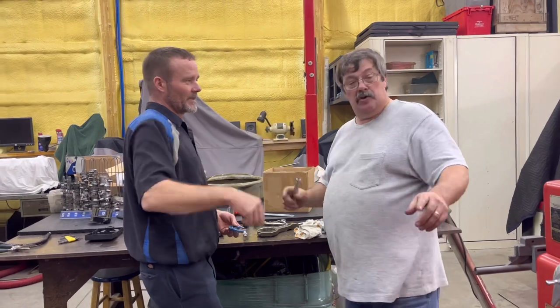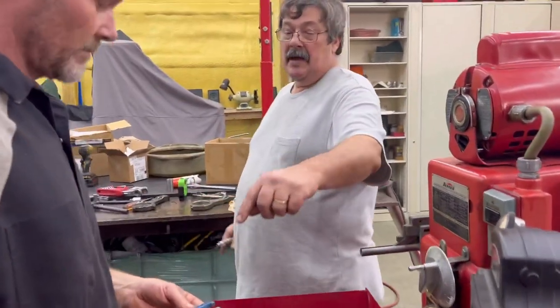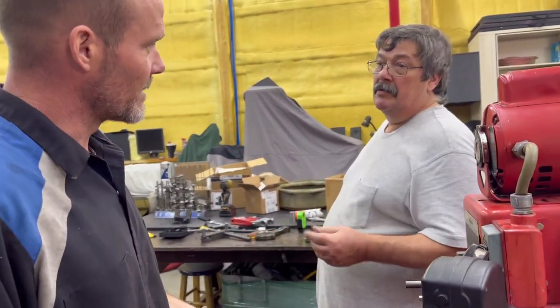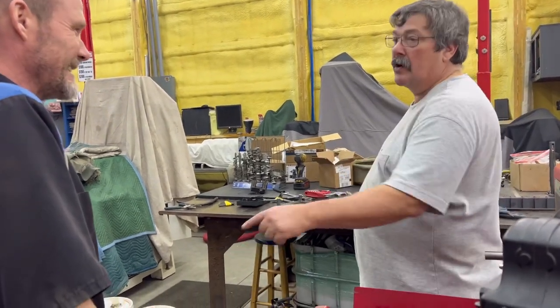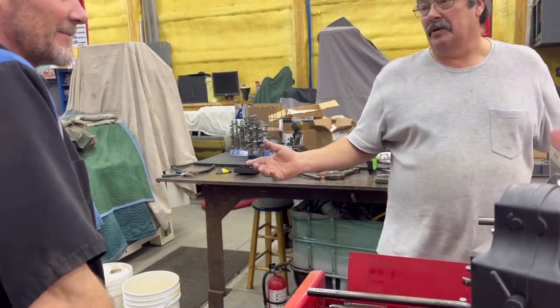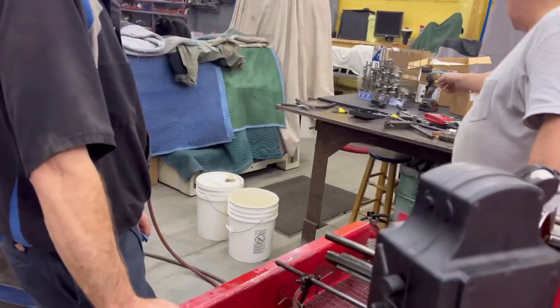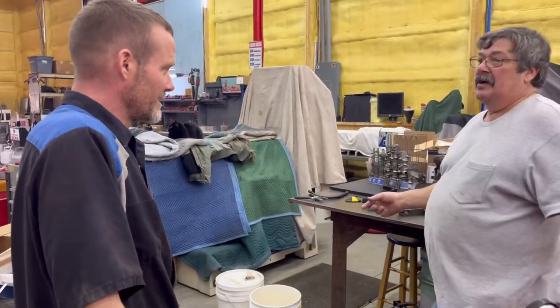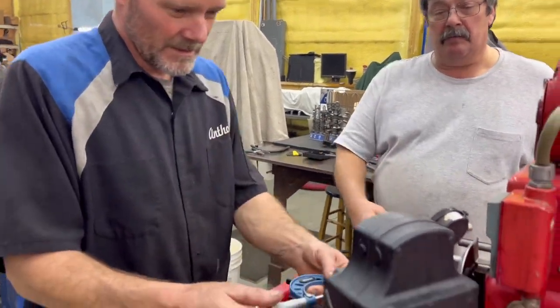But what I wanted to show you is when you had that gizmo on there with them two wrist pins, you set it. That set it differently, didn't it? Yeah, it was about a 3/10 different. Really? Like, which one's right? That one's right. Remember, you over here with that big clunky thing. Most people set with them. This is supposed to be a quicker setup, just to do it easier. But I'm more anal. I just used the mic and set it. So put it on there and reset your zero.